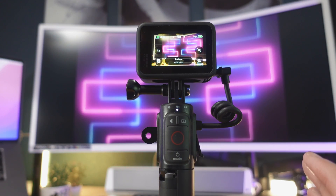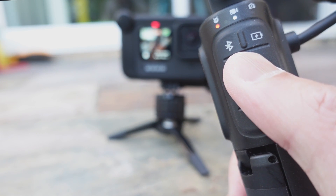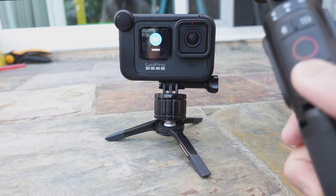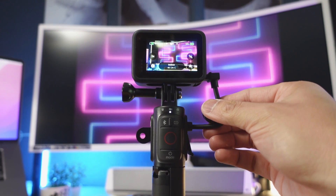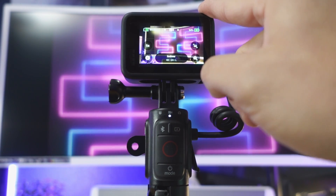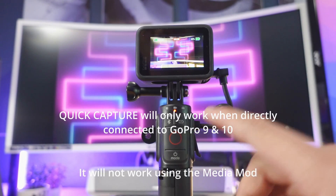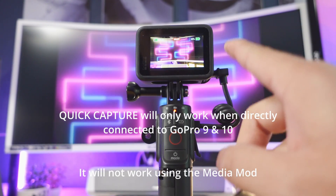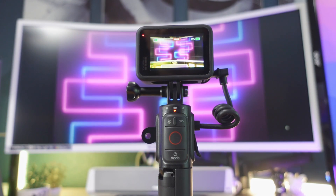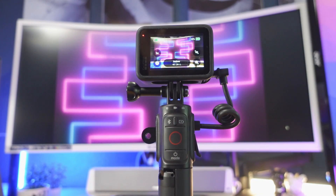You can also use this remote wirelessly as well. When you're away from your camera and you don't want to walk back and check, you can just look at the recording indicator right here — red means it's recording, white means it's not. Just to let you guys know, the wired connection will only work with the GoPro itself; it will not work with the media mod. If you're using the media mod, you have to connect wirelessly. Quick capture will work if you are directly wiring the Volta grip to the GoPro itself without the media mod. When you're using the media mod, there are a couple of functions that will be missing.